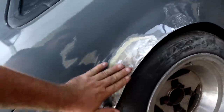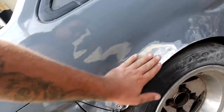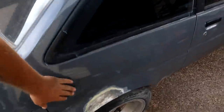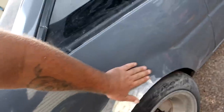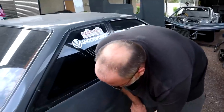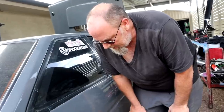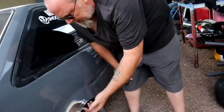All right, so this is where I've got it back to. Back to bare metal, cleaned up. Definitely going to need a skim of bog on here. So I think there was a skim already, wasn't there? Yeah, on this side, gave both sides a bit of a skim. So I need to re-skim this side, clean up this edge to get it mint again. Have a look, see what I've just cleaned it up for now. Do you want me to chuck some etch on it for now? Yeah, definitely, we need something to insulate it from the environment. No, that's fine, man. See, this is 2 mil thick. Yeah, so it's definitely thicker stuff. I'll get some etch primer now and just hit it with etch primer, and then wait for the next stage.